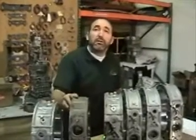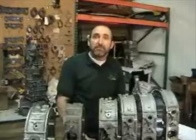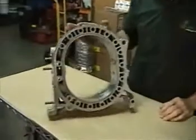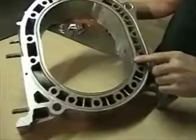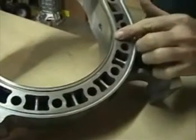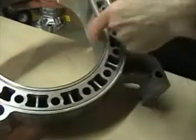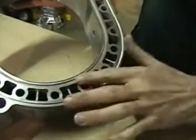Now let's take a better look at how to do some of these inspections more carefully. Let's look at common damage from an overheat — I'm going to use this brand new housing because it is much easier to see. The first thing we're going to look for that would determine right away the housing is not worth further inspection is damage to the water seal grooves. The hottest area of the motor and the most common area for failure will be the area below the lead spark plug.